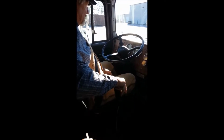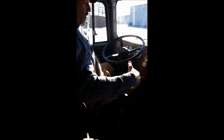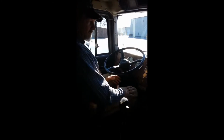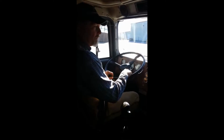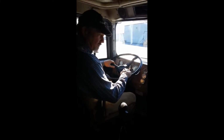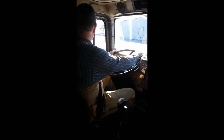In order to go into the first forward gear, I'm going to go clutch to the floor, 1, 2, in. I didn't quite go in, so I'm holding it against the gear. I'm going to let the clutch come up very, very slightly, and it pops right into gear. The oil in the transmission is very thick right now, so it slowed off and came to a stop very quickly. Alright, so check my mirrors, creep forward a little bit here, get a straight truck and trailer, and get some mirrors adjusted.